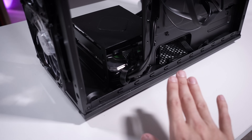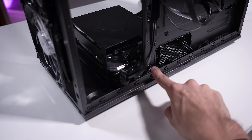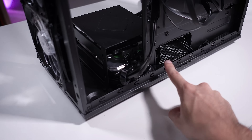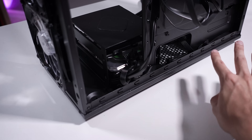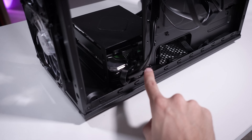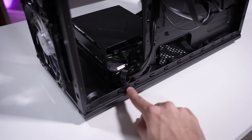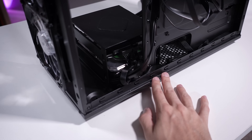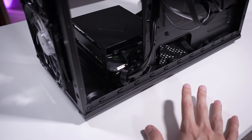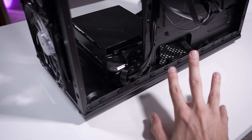From this angle you might not be able to tell, and that's totally by design. The SATA power cable is already connected and I wanted to show you how concealed it was — we were able to tuck it in between the channels of the case. The excess cabling and excess length we're not going to use is totally out of sight; very minimalistic. It didn't interfere with our SATA data cables at all, and these little ridges aren't really part of the structural integrity of the right side panel. So it's nice that we have that little bit of space there, because we are going to have excess 24-pin and 8-pin EPS cabling that I have no idea what we're going to do with — we'll have to finesse some things.